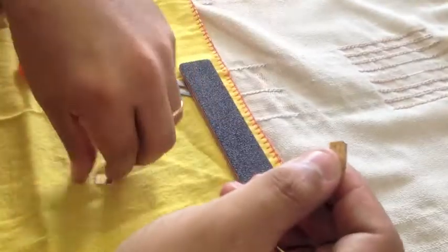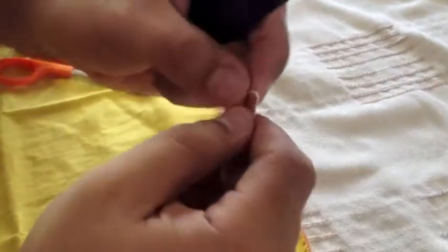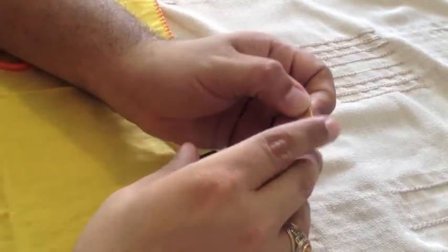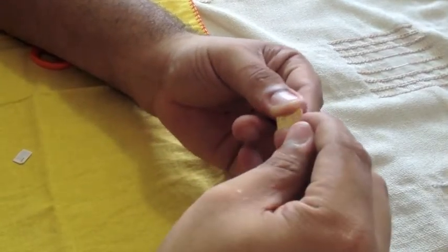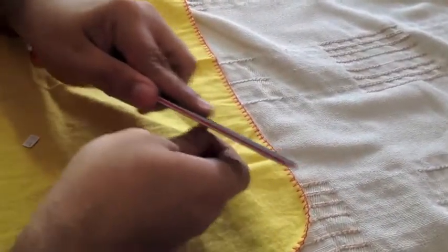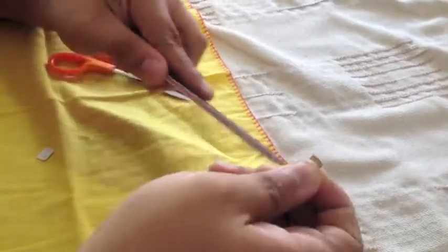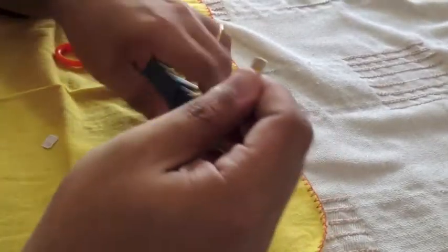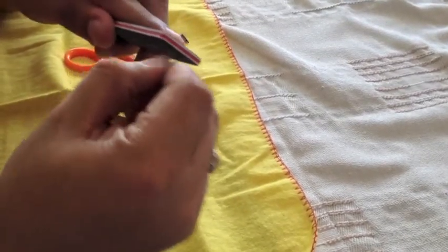All SIM cards have a little different shape on one of the corners, so mark that. After this, you need to start taking down plastic from the horizontal sides — you have to trim along those lines. It's going to smell a little nasty, so if your nose is sensitive you might want to get a mask. You're going to be trimming down all of the plastic, and when you get to the actual chip you have to keep going down.